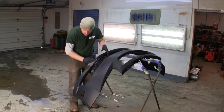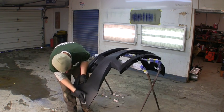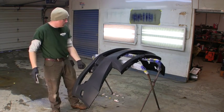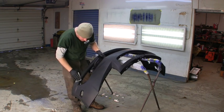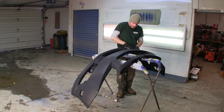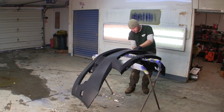I'll probably reseal over this just because that's what I do — do you need to? Probably not. These pads — if there's any orange peel, like when you're prepping a blend panel, they knock it down fast. It's really amazing how fast they cut and put a scratch into it, and they're supposed to leave a really uniform scratch. Of course all expensive sandpaper claims that, but we'll see. Next time I have to do a cut and buff they have a dry sanding option for sanding out orange peel and dirt nibs.